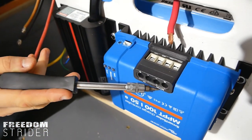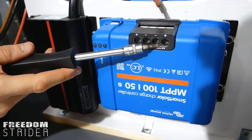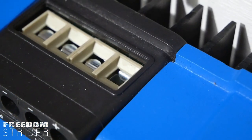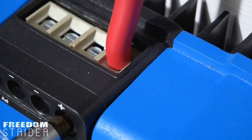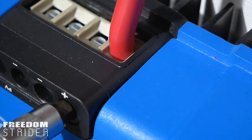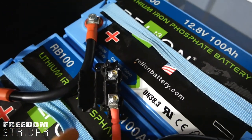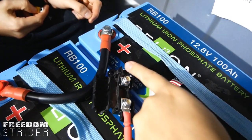With the MPPT, we put the cable into the battery positive terminal. There's a flat-head screwdriver screw that you can use to tighten and loosen the hole. Loosen it all the way and you'll see an opening being created at the top. Slot the cable in, push it down, and whilst pushing it down tighten the screw — essentially the MPPT is crimping itself onto the cable. Give it a tug and that's not coming out. Now that that's in, we reach the fuse which is right here, put the fuse in, and then we need another length of cable on the other side.